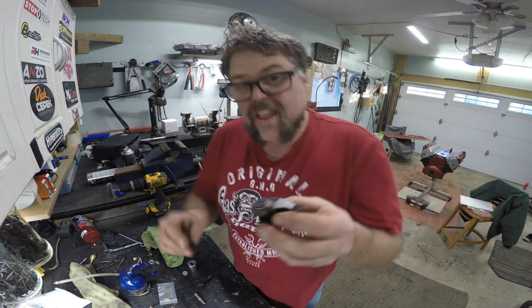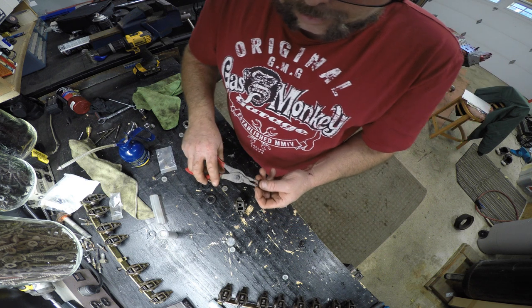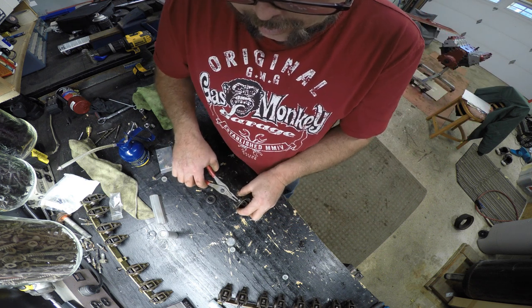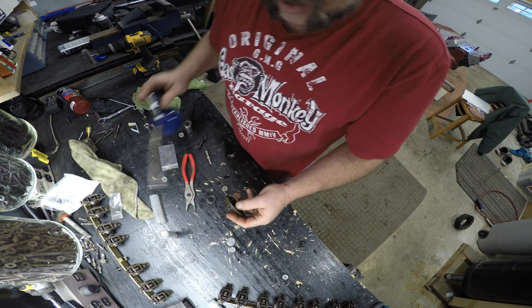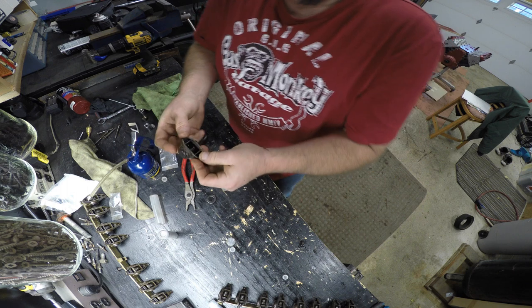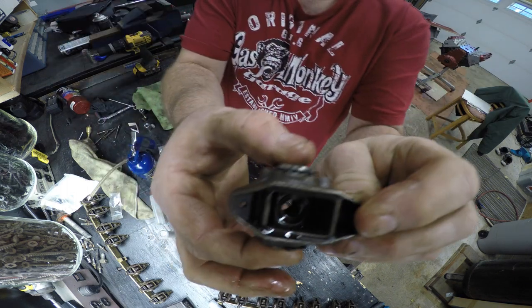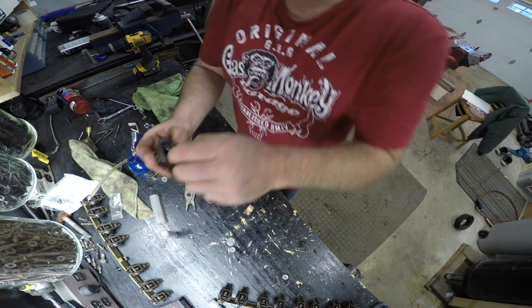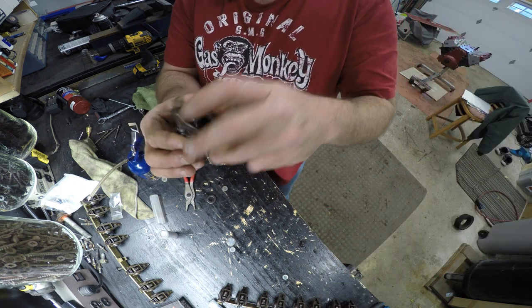So now after you're done that part, you take your Snap-on tool here with a collapsible ring. So you put one ring on one side, other ring on another side, add a little bit of grease or oil, like I like to do on everything I do. And there we go, she's done. Now it should have a little bit of play side to side, and that's about it. That's decent. Comes with new bolts too. There you go. So there's one.